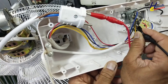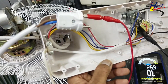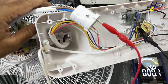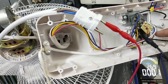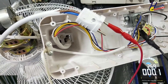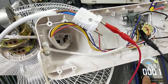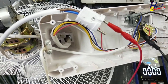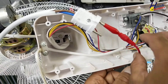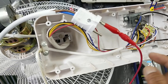The yellow wire connection is showing open circuit. Now I will turn on the speed selector. It is showing zero ohms, which means this switch connection is good — it will make a connection for the swing motor and synchronous motor. At all three speeds it must remain on, and when in the off position it will give open circuit.